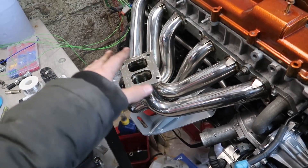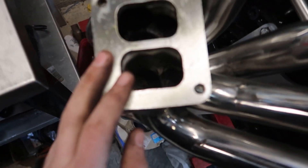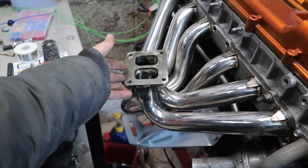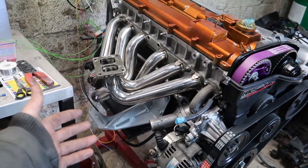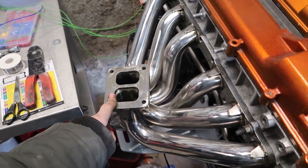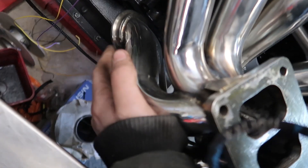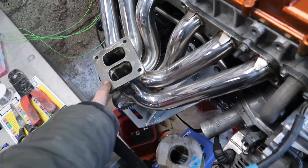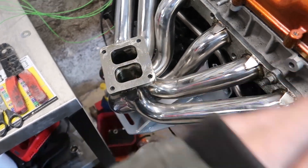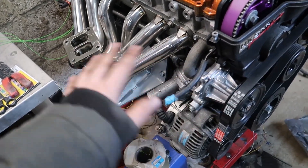As you probably saw in one of the previous videos, we put this manifold on. It is a cheap junk eBay manifold — it was like 190 quid or something. The welds inside are questionable; it looks like I welded it and I don't really know how to weld. It looks pretty from the outside but I will be upgrading to like a Walton Motorsport one in the future. The budget doesn't allow for that right now. It's got the little V-band 44mm for the wastegate down there. The only thing is this is T4 and the turbo is T3 — I'm going to buy an adapter that goes from T4 to T3 and run that for now until I upgrade the manifold.